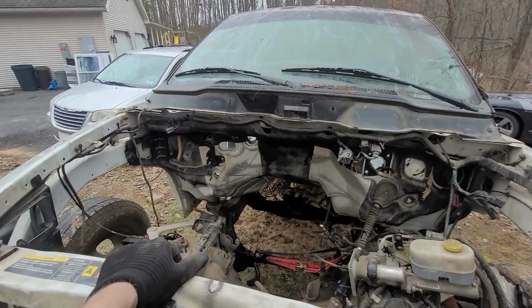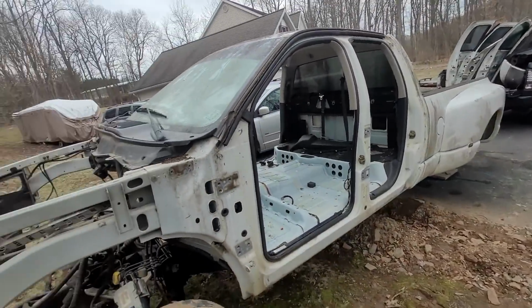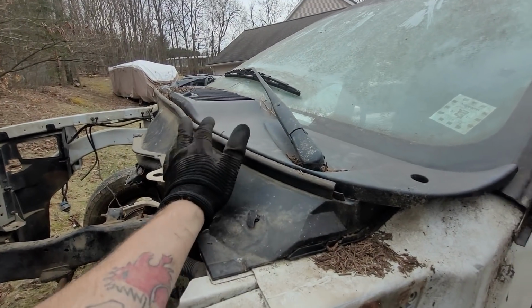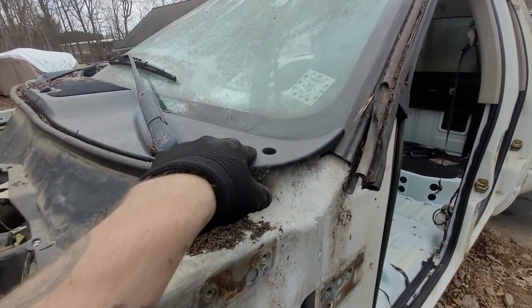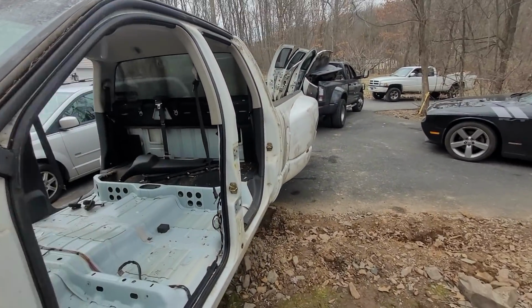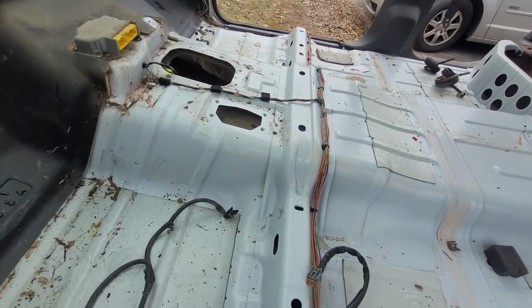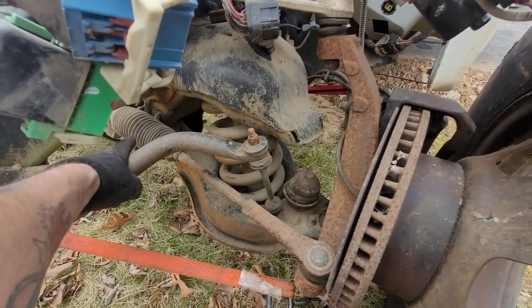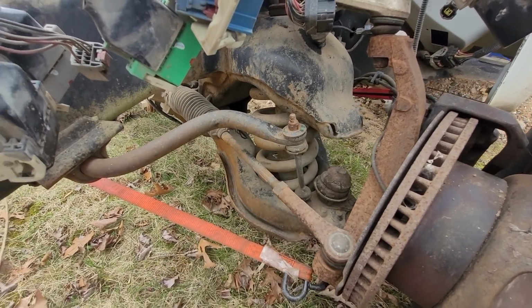Oh, here's about where we left off. So, everything's stripped. I know I should take this and probably replace mine, but I don't know yet. We'll see. Mine's broken on one side, so maybe. But everything's cleaned out for the most part. Maybe come in here, hit it with some compressed air. Then take the boots off on here, and then just put a vice grip on both sides of this so that the steering can't go anywhere.